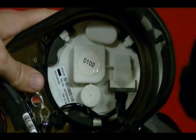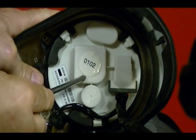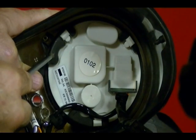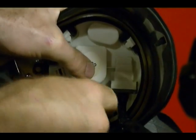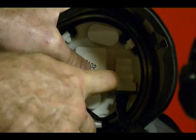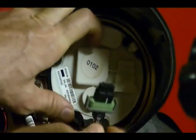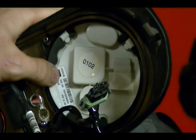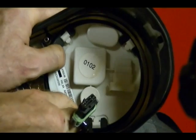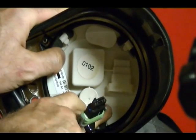The speedometer just snaps into place — there are three snaps: one, two, and three. The white snaps are part of the speedometer body and the black piece that it snaps onto is a separate piece. Before we unsnap it, I need to remove the electrical connector here. First step — remove this connector and pull it out of the way. Then I can remove these snaps. The way I do that is I just pull this black piece back and push the speedometer that way, and that will release the snaps. I want to do that for all three snaps.